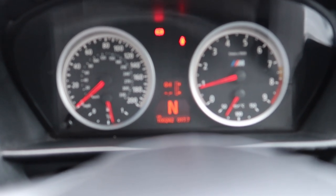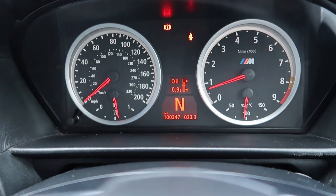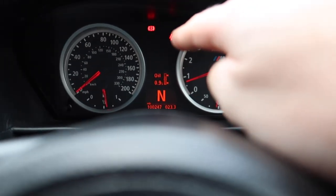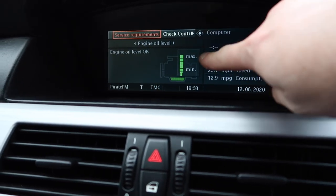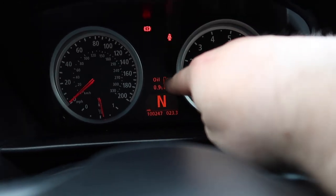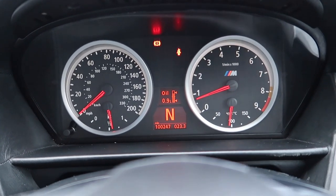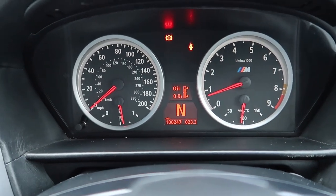I've just taken the car for a drive and as you'll see now it's showing 0.9 liters under on the iDrive, which means it's sitting at max. I only put eight liters in, not the full nine — that's what BMW state as well: put eight in, run it up to temperature, check the oil, and fill up if necessary. I don't need to fill up, I'm happy where it is. Before the oil change it was showing 1.5 liters low, so I'm very glad I got it out. Oil level is up and that's the oil service done. Make sure you only put eight liters in first on the S85 and then check it, otherwise you'll overfill the engine. We've got the right amount of oil.